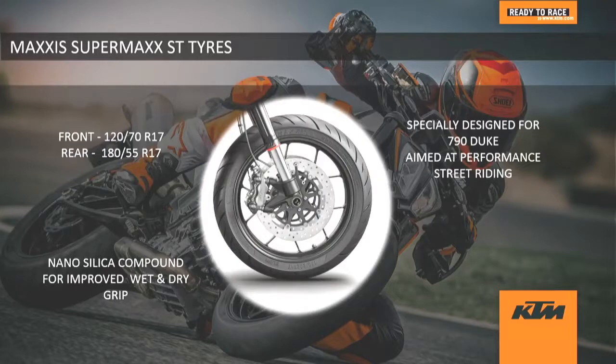The 790 Duke contains Maxxis Supermax ST tubeless tires, which are placed on extremely lightweight 17-inch aluminum rims. They feature a nano-silica compound built specifically for the 790 Duke for improved wet and dry grip. This ensures an outstanding balance between aggressive handling on one hand, with high-speed stability and everyday rideability with low, consistent tread wear on the other.